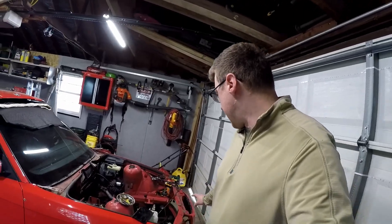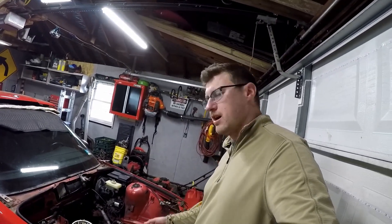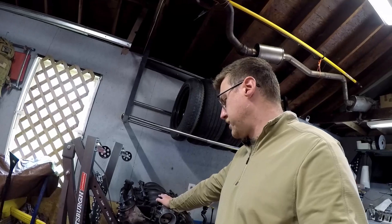The TR6060 is from a 2014 Camaro SS. I went ahead and ripped off the front end — I just temporarily set it back in place — and started cleaning out the engine bay, removing AC stuff and things I don't need. Today I'm going to focus on cleaning up the LM4 and start test fitting it. I need to make a mount for the transmission and get measurements for the driveshaft.